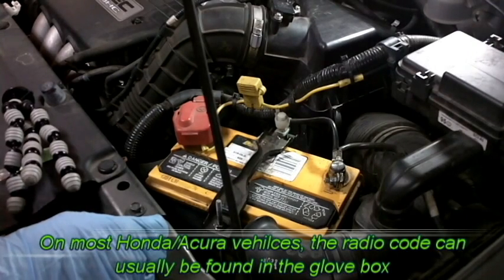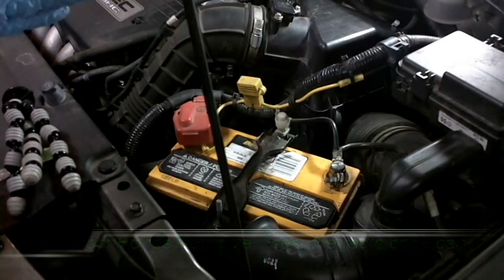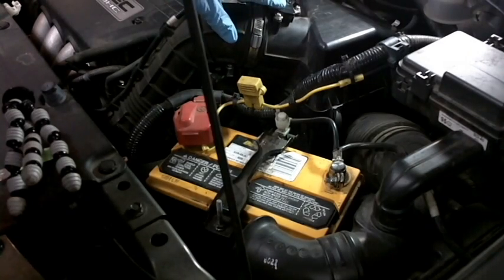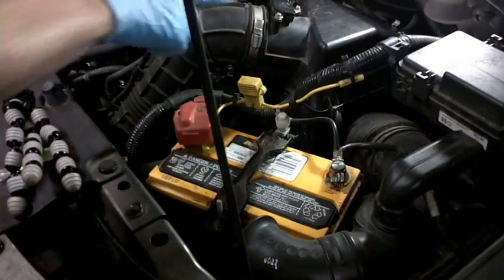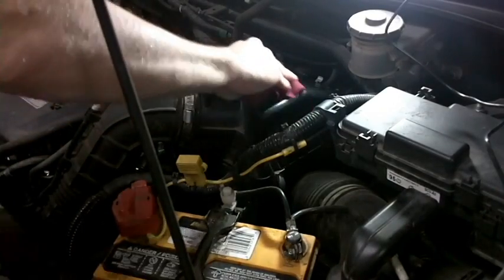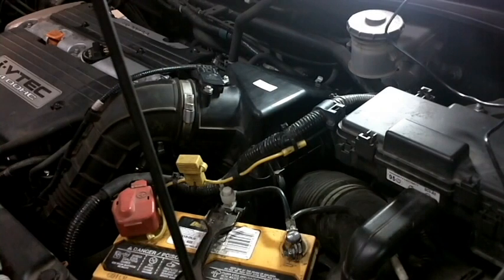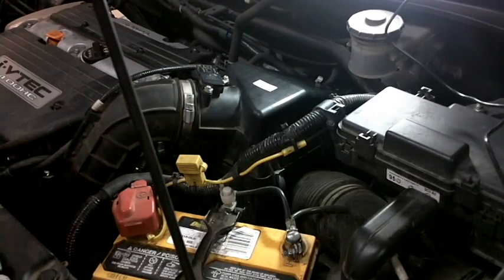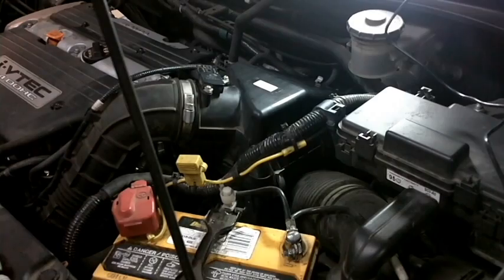I think that's about it — we'll see how it runs. I'm thinking it's probably going to be a little smoother than before. You might see MPG improve by 1 to 2, who knows. We've got a fresh breather and we're now computing a better calculation of the airflow coming in, which gets fed into the computer as it uses more or less gasoline to match the airflow. Last but not least, I like to wipe off where the old date tag was and put a new one on there, just so I know when I changed it — I changed that in December 2012 while shooting a Man Club video. I'll just tape it on there and that'll last for a year.